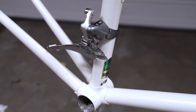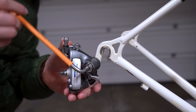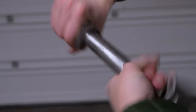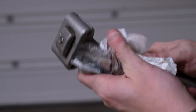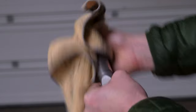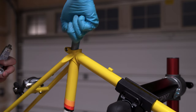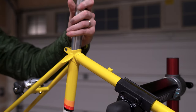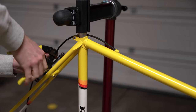Here we have the newer version of the front derailleur. And here's my little pitch on anti-seize: I've been using anti-seize throughout the video. Grease is of course always acceptable for making sure parts can be removed down the road, but ultimately grease will dry out. Especially for bottom bracket shells, any time you're talking about the interface of two dissimilar metals — for instance, a steel frame and an aluminum seat post — anti-seize is going to make it so that in 20 years this seat post is going to come out no problem. If you've got a choice, I would prefer anti-seize for those kinds of applications.